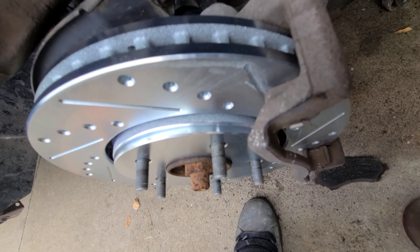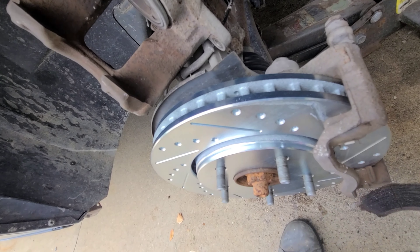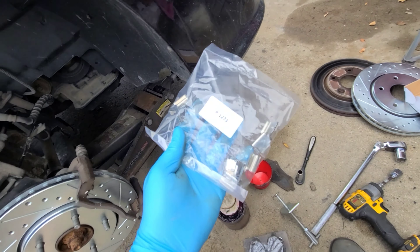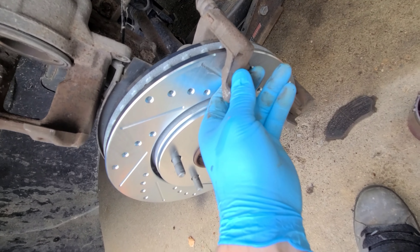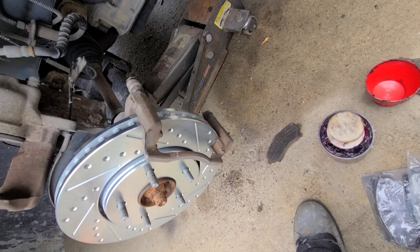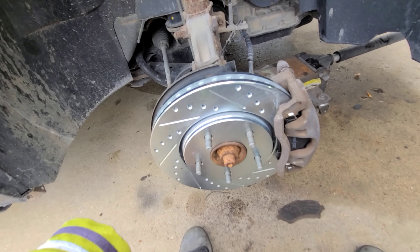We actually got a Detroit Axle kit. I know it's a minivan — drilled and slotted, super overkill — but why not. I'm gonna open up my front brake pads. We have ceramic pads and a new set of hardware. These just pop out easily — this little guide is for the brake pad to ride in. Get rid of the old ones, put the new ones in, they just push right in with your finger.